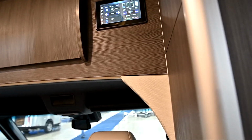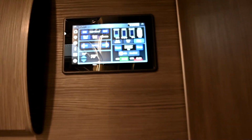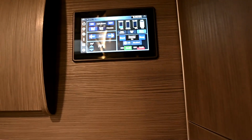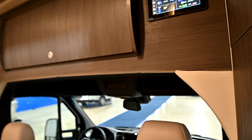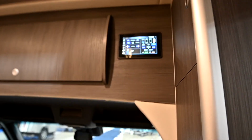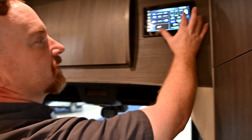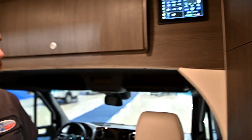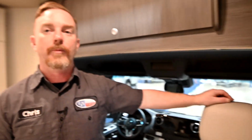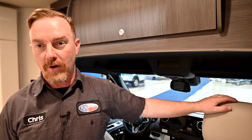First, we'll turn the control panel on and simply press extend. They will extend on their own and level the van slightly. You want to make sure that you remember to bring these back up before you attempt to drive away. Just like so.